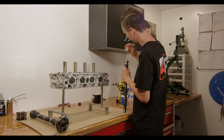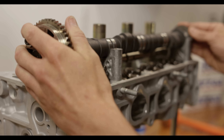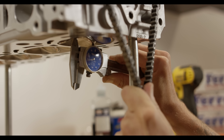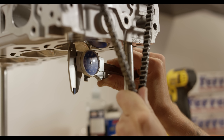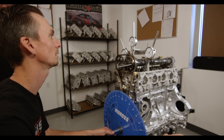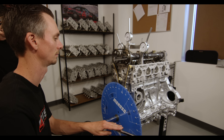On top of that is our Four Piston billet turbo three-lobe camshaft. This engine has VTEC capability so that it idles and behaves like stock on the street, and it also has variable intake cam control so that we can control the centerlines from 132 degrees all the way down to 104 degrees just by moving the cam electronically.